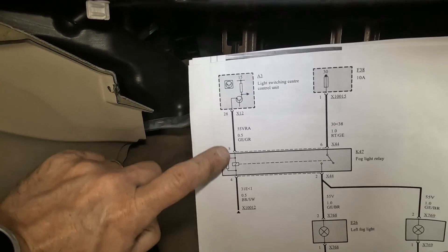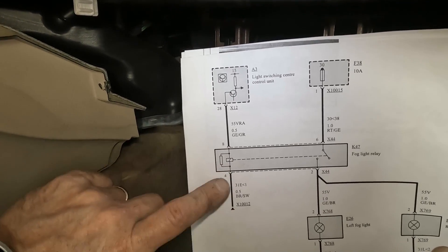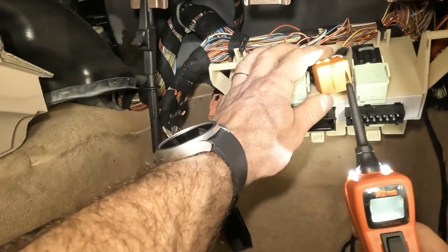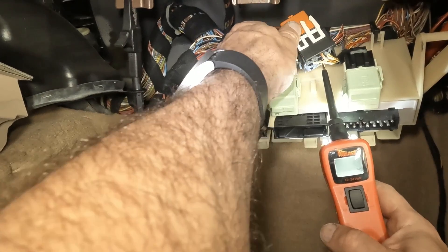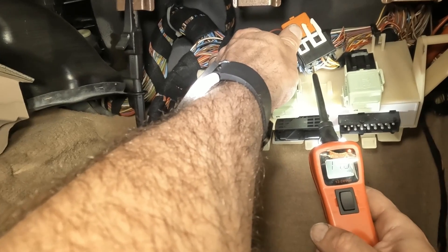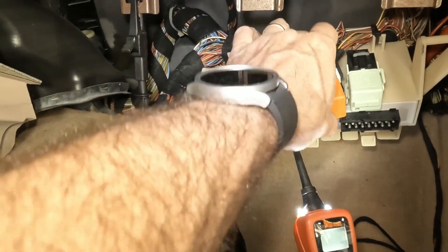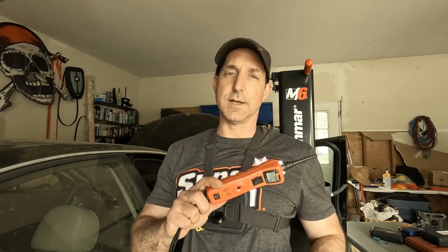Here's our diagram again — we now have power at pin 8 of the relay, and the relay is activating because we know the ground is good on this side. Let's check pin 8 — now with the GoPro on my head and both hands free, here's the relay. If we flip it over, we have a yellow and gray wire, and now we should have power on that pin where we didn't have it before. 11.6 volts. Our circuit is now working correctly. You can do all of your diagnosis right here at this relay — that's what's so exciting about being able to break up the circuit this way. A lot of people are intimidated by electrical testing, but if you follow some simple steps and understand how the basics of a circuit work, it's not that hard, especially when you have a power probe. I highly recommend the KZ Power Probe — I'll put a link in the description box.